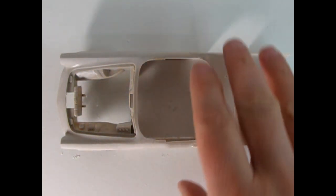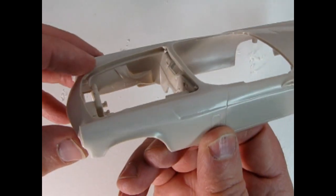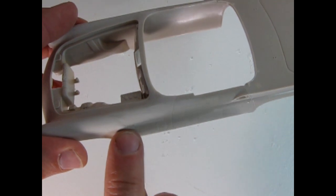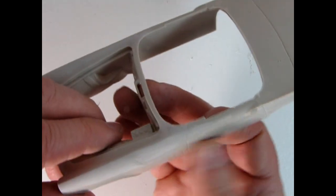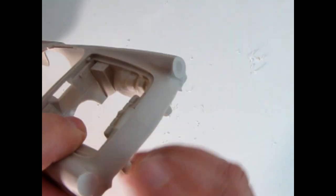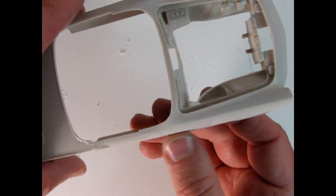Here we have the body with the front portion de-chromed. All the little vents are taken out and as you can see it's nice and smooth. There is a bit of an angled line here before this body molding — it's not really a molding, it's more like a ridge in the panel. There's the front sanded off nice and smooth, the removal of the Thunderbird logo, and the Thunderbird script on the side, and the vents.